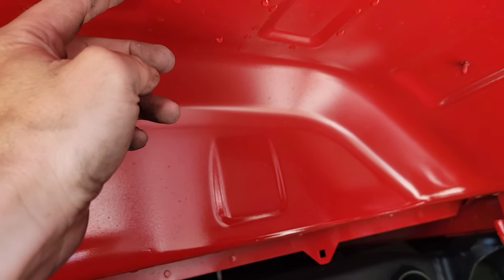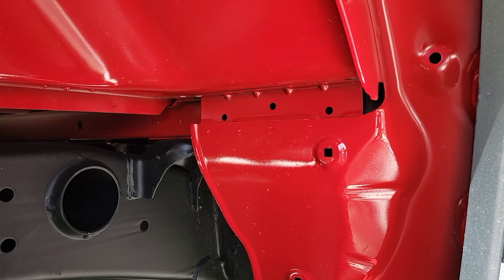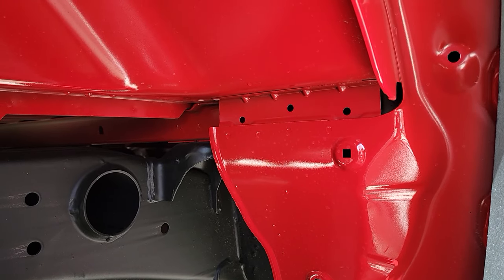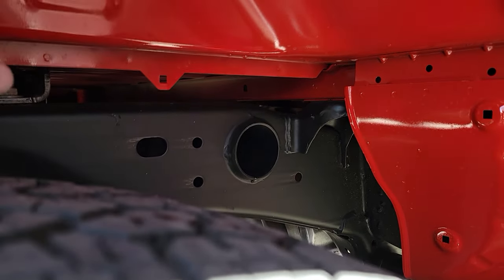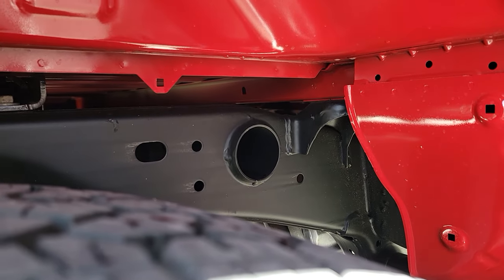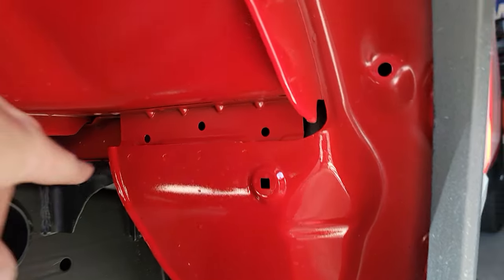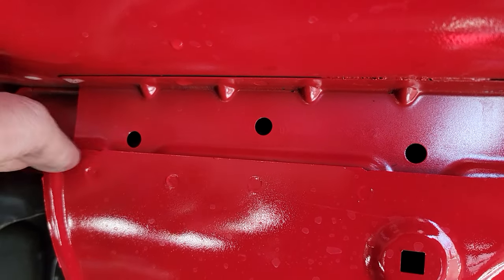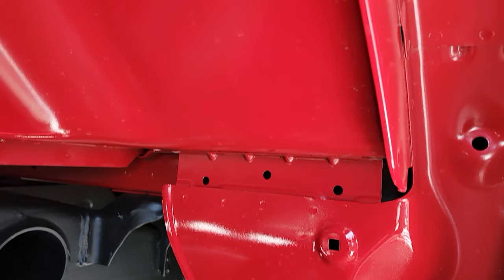If you're going to put these liners in later, make sure you watch yourself — those screws are sticking down and they're real knuckle busters. I went ahead and cleaned this because even though it's already been washed, it gets dirty constantly from high-velocity spray underneath from your tires. This paint's just not going to last as long — go out to your truck if you don't have liners and after about 60,000 miles it's probably going to look a lot worse.